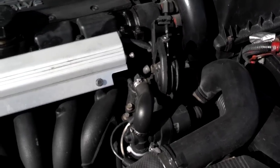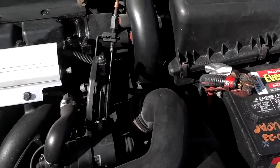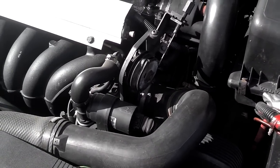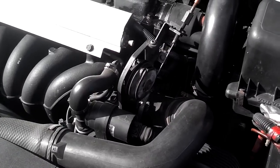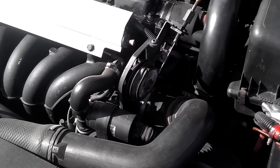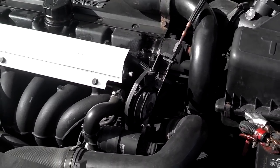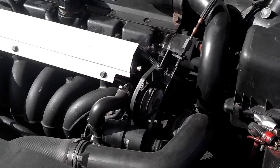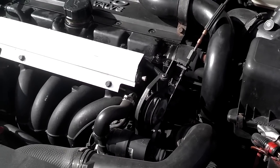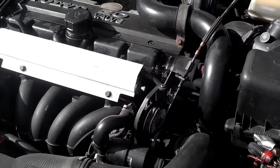Another thing I highly recommend is checking and servicing your transmission. Look at the owner's manual or the link below for the proper way to check the transmission level. A lot of people think they can gauge the color of the fluid by looking at the dipstick — to me it's not a real good gauge. It may look red on the dipstick, but drain some out and it's brown as pond water. I recommend making sure the level is right, then changing the fluid as recommended in my link below — not a power flush, but a series of drain-and-fill cycles to refresh the fluid. I've seen these cars with more than 500,000 miles on the original transmission.